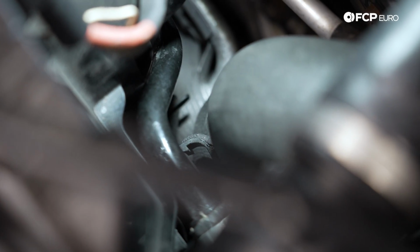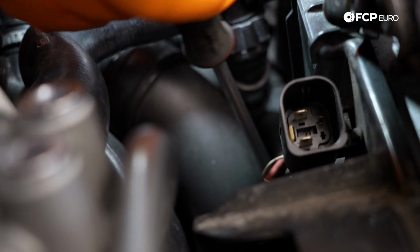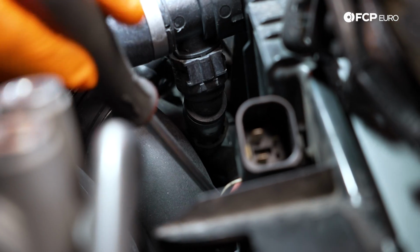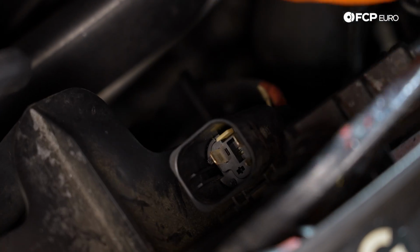Now our goal is going to be to get this little clip on the rubber bushing on the fan shroud. We should be able to just push it on and over, especially since it's been on here before. We're going to do that before we adjust the coolant line. There we go. Underneath this coolant line, there's another clip that's on our fan shroud, alligator style clip. We're going to open that up, and then we can pop that line in. You might find it easier to leave the clip on the hose and just attach it from the shroud. But for us, it was pretty firmly stuck in the shroud. So we just went with the route of opening it up and popping the line out. So now we have the little bit of a tedious task of just popping this open, positioning it correctly, and getting that open for our line.